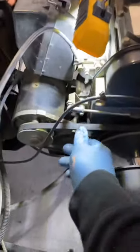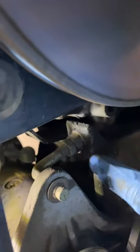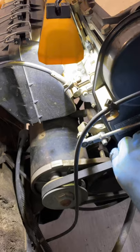Now you can see the generator belt right here. There are two bolts we're going to loosen. Down here at the tensioner, there are two nuts — we're gonna loosen the top nut all the way up, then loosen the bottom nut all the way up, which will force the generator to push down and loosen this belt. But before we do that, you can see a bolt going through this side of the generator with a nut on the other side. We'll get a socket on this side and a wrench on the other side to loosen it.